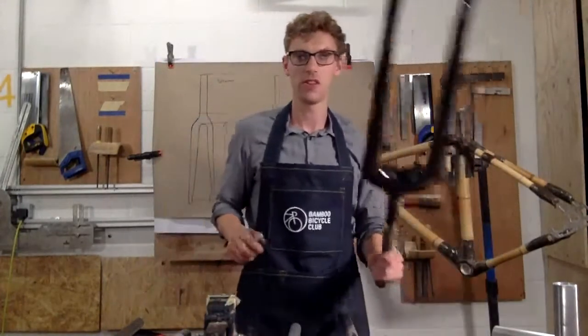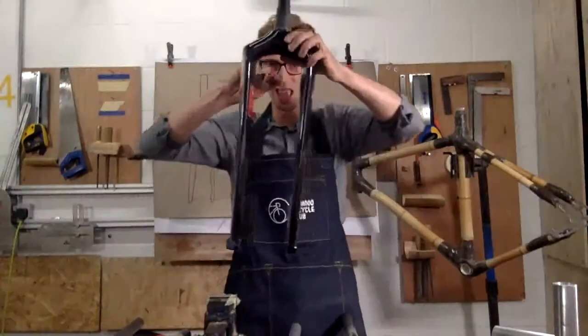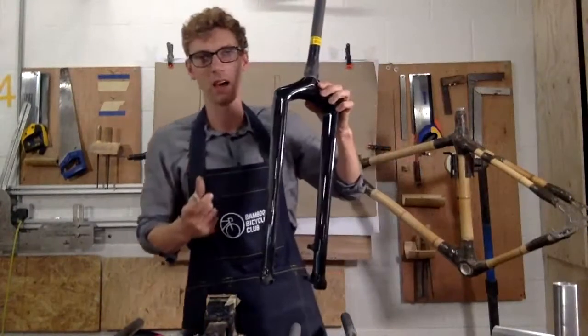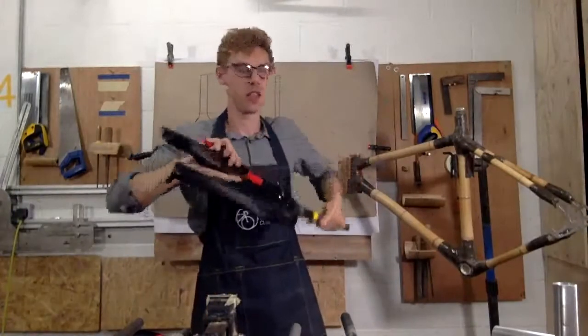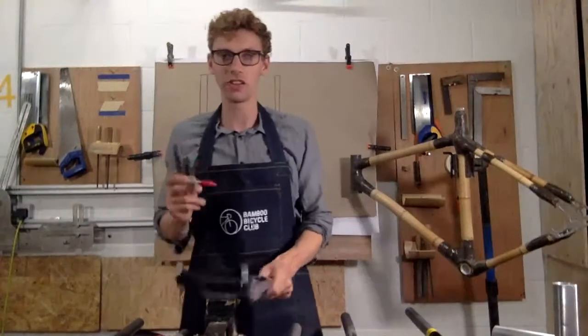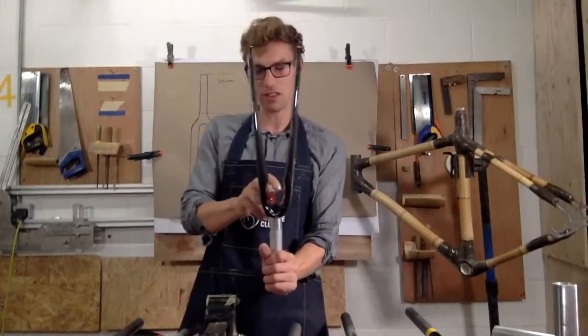So this is a mountain bike ready fork. You can see very simply the clearance here will allow you a really, really big tyre. If you pick the wrong fork, you're not going to be able to fit the large tyre size. So just be really careful. And this is more concerning when you're picking a road one like this. You can see how narrow this is in here.